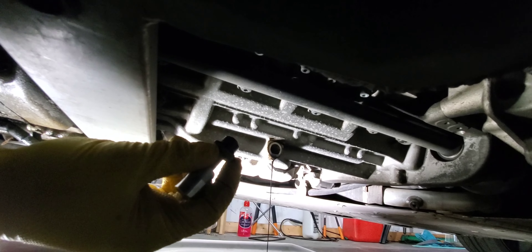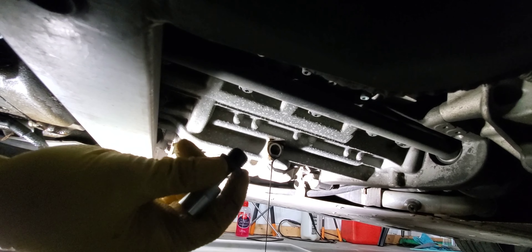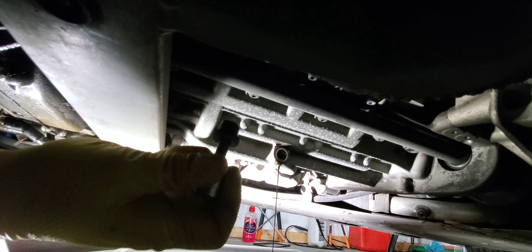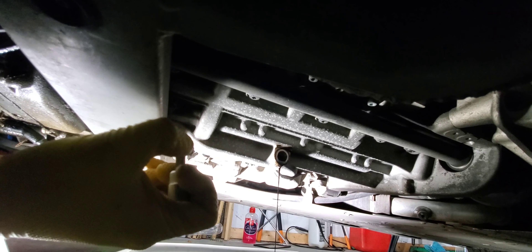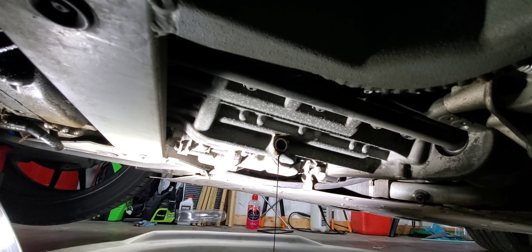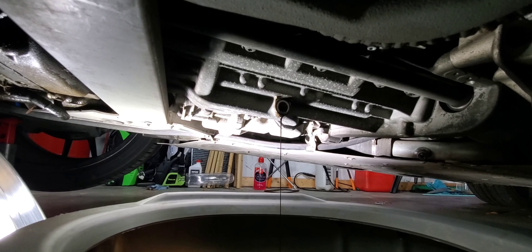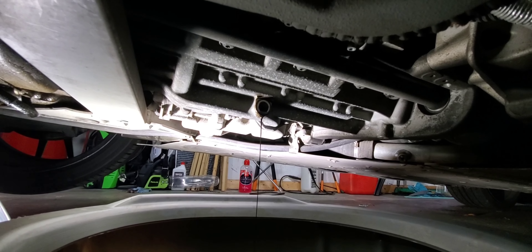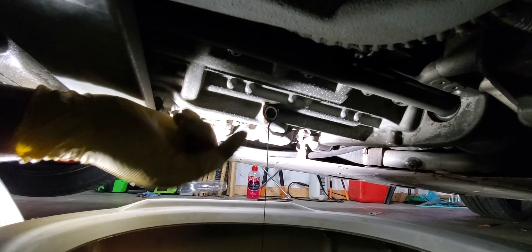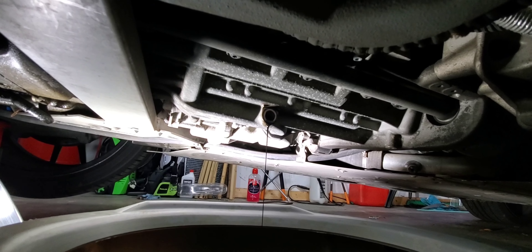I took my 3/8 drive off so that I could use my fingers to turn the bit right here — slowly back it out, slowly screwed it out so that the oil wouldn't shoot out too fast. Got it into my tray right here. It was gushing out at a high rate; there was a lot of fluid coming out.